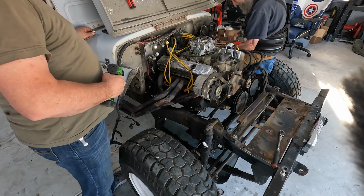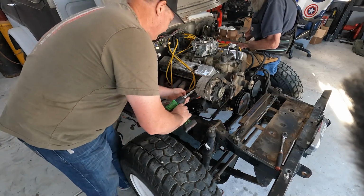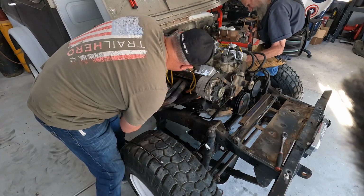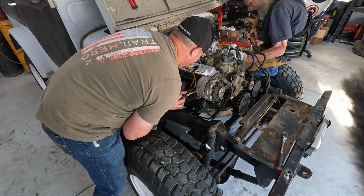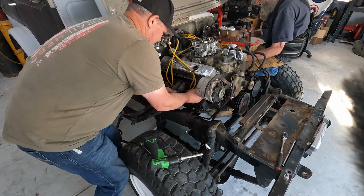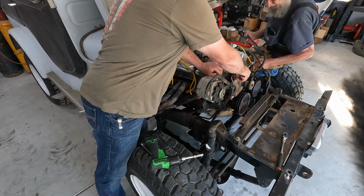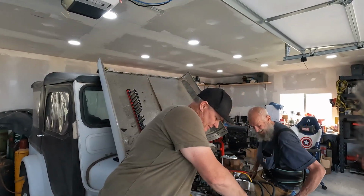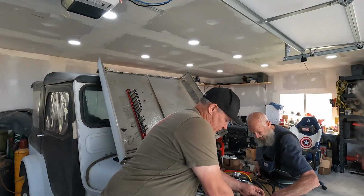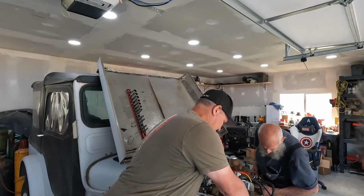We're going to go ahead and pull headers off of this. Pop's going to work on that side. I'm going to knock the ones out of this side. Get the headers off of it. I got a stowaway alternator. Alternator bracket runs plumb up underneath the header. So we got to take the upper alternator bracket out before we can pull the header back out of the way, even before we can lean it away from the motor. All of these goodies are holding us up.